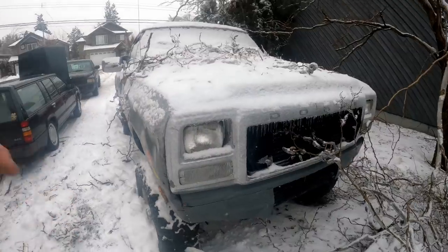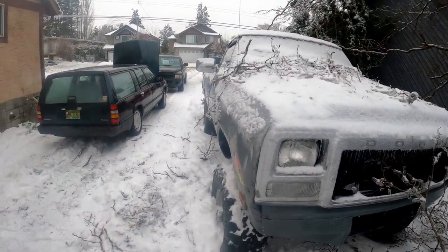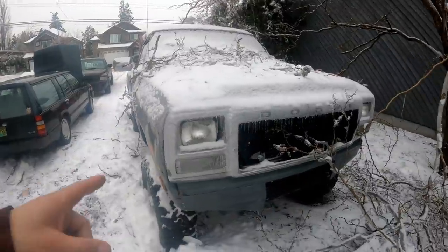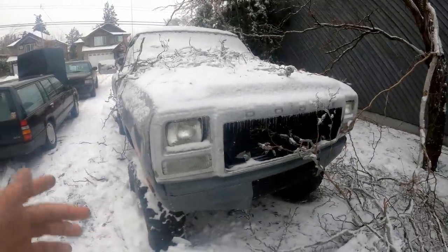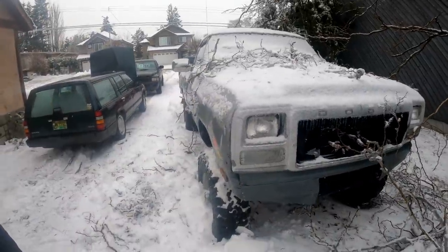But yeah, this truck's pretty cool. Obviously we can't pop the hood for you guys right now, but it's still the same motor setup as before, hey? Yeah, all the same. So it has a 62mm BorgWarner turbo on it. It's got this third-gen intercooler, which for an off-road truck seems almost a little sketchy now.